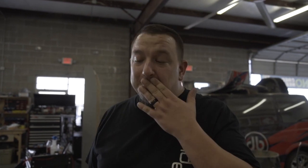So I got a 2-ohm load on this amp. We got an amp that's rated at 5,000 watts at 1 ohm. At 2 ohm, it ain't gonna do much. And it sure didn't. So we decided to redesign the box, because apparently this is the worst box I've ever built in my life. Turns out it was probably one of the better ones I've ever built. My specs, though.